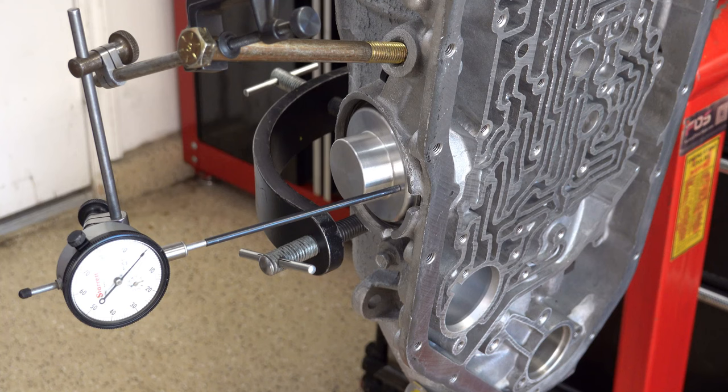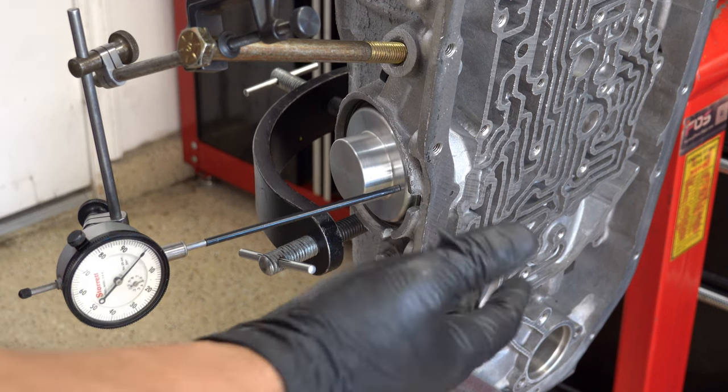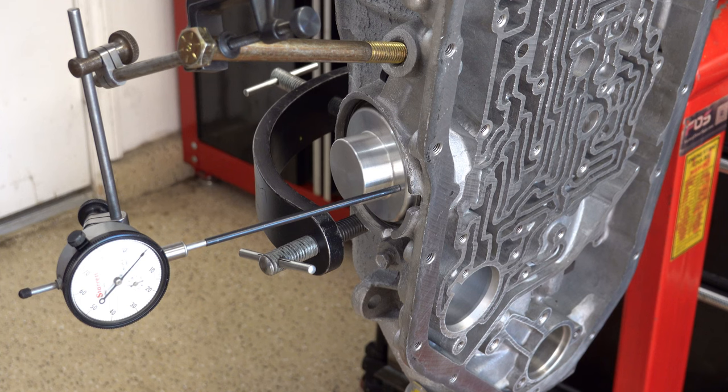All right. I think I'm close to where I need to be in terms of servo travel. So I have a contraption set up with a dial indicator. The indicator is stable. What I'm going to do is press in while I'm grabbing the fixture and the inside of the case bore here on the servo, and see how much that dial indicator is moving. Again, we want to be between 75 and 125 thousandths worth of travel. Any more than that is considered out of spec. And this procedure and these specs apply to the 2004R, the 700R4, and the 4L60E, all variants, all years.